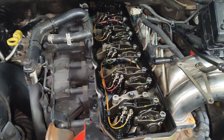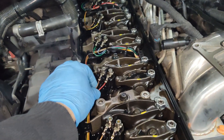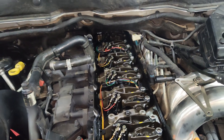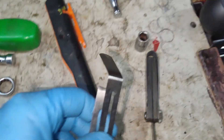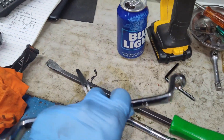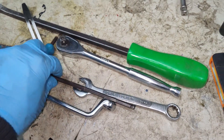For cylinders five and six in the back, you may feel like there's not enough room or that the injector wires and harnesses are in the way. You can remove the whole gasket assembly by disconnecting the harness connectors and injector wires if needed, but it's not necessary. What does help in the back is bending your feeler gauges to fit. A box-end wrench angled appropriately also helps for tightening the jam nut back there.